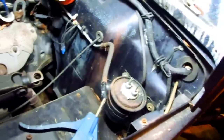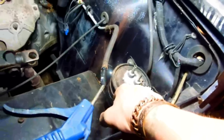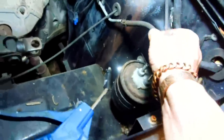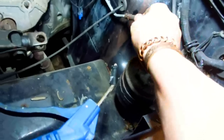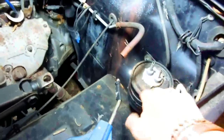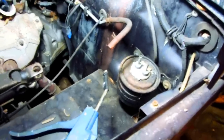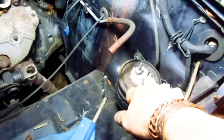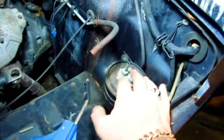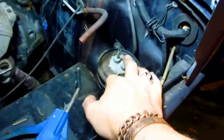I have the gas cap off, so the line is clear all the way back — but this canister is clogged, so I should replace it. This was an emission system added years ago: instead of gas vapors going out through a vented gas cap, you have a non-vented cap and vapors go into the charcoal canister. This line goes back to the fuel tank and this one comes out into the carburetor, or fuel injection, whatever the system is.